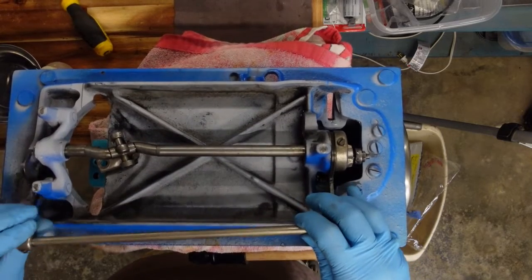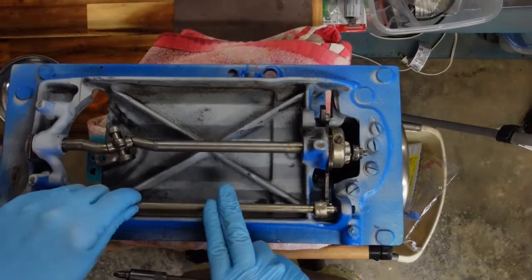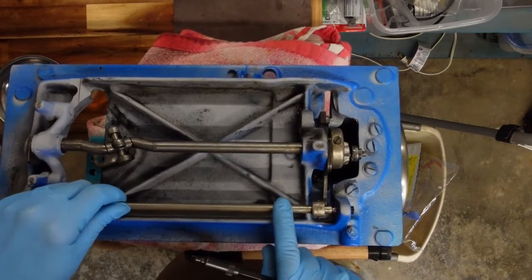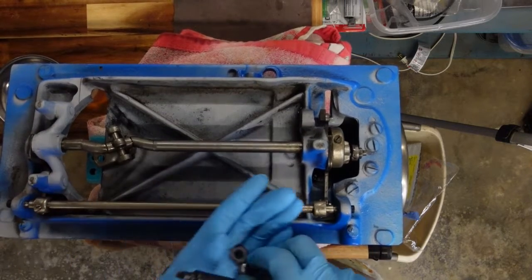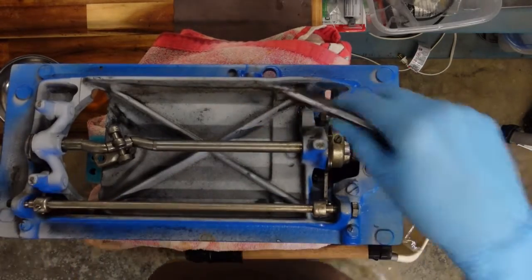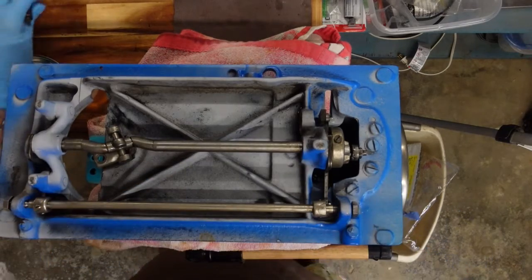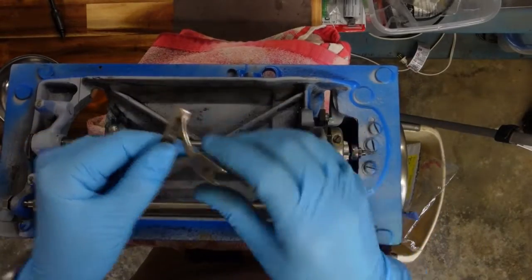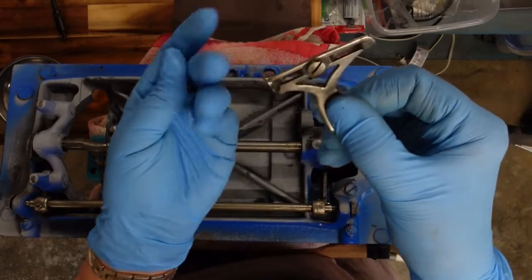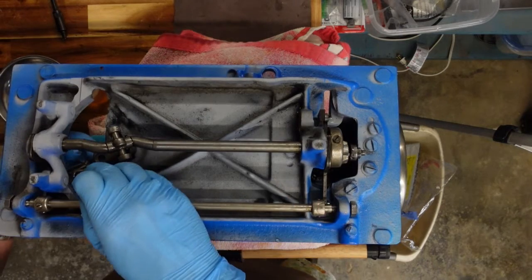I need to adjust this side over here. Let me get these pivot screws in here just to hold this in place for a moment. I did put this bar back on the bearing, and I know this is not final adjustment — it's very wobbly — so I'm just going to put my little nuts loosely on the end because I don't know if I'm going to have to do something finagley to get that stitch-length block in. While I'm in here and things are pretty easy to access, I'm going to go ahead and put my little bobbin holder back in. I took her completely apart and cleaned her up, so she is ready to go. There's just one screw right here that I'll need to put underneath.